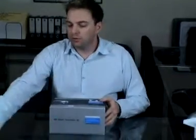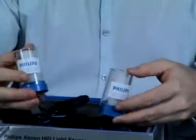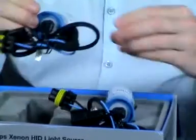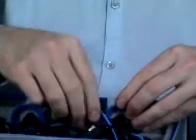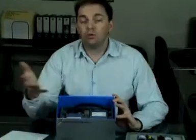So they're the 3 supervision kits that we do, and of course the final kit for the car is the genuine Philips HID kit. Now, the bulbs in these kits are actually manufactured in Holland. They're original Philips bulbs. They are rebased in China, which means China will make all the different socket types for these globes, H1, 4, 7, etc. The ballasts in the Philips kits are also CAN bus compliant, so you can run them on a CAN bus or a non-CAN bus car.